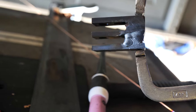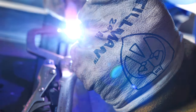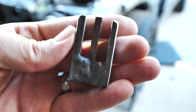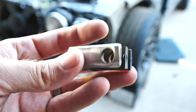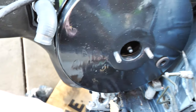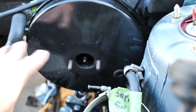That's welded up on that side and that one's welded up there. I'm going to hit it on the back real quick as well - just TIG'd it up. So I've fully modified this clevis. I've ground down this side just a little bit to make it thinner, just to make sure it doesn't interfere with the brake pedal area - I don't want any binding on the brakes. I put the booster in as well and gave it a quick paint job. It turned out okay but in one spot it kind of leaked - one of those two-footer parts that didn't want to stick, maybe had some grease on it.